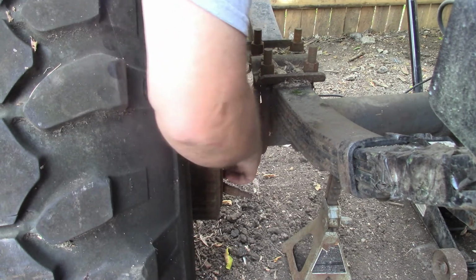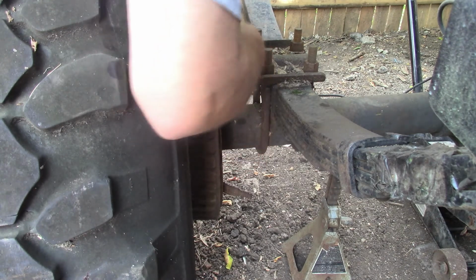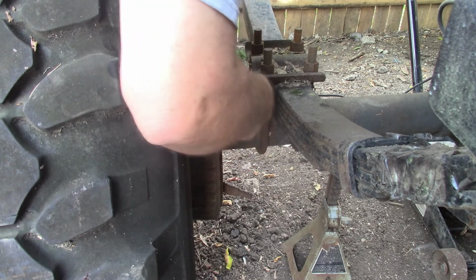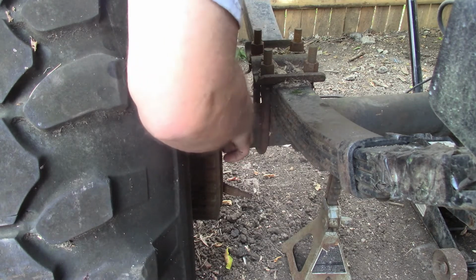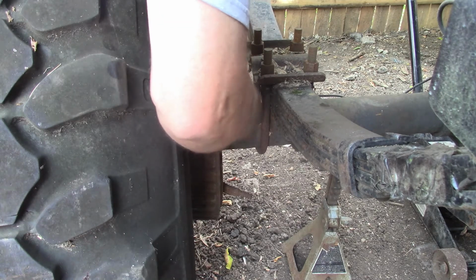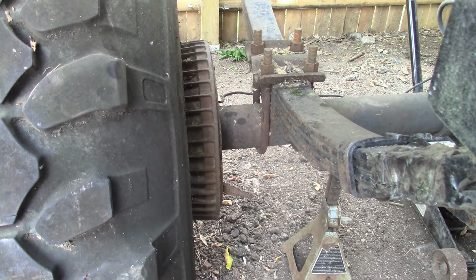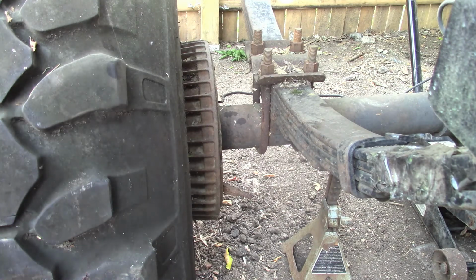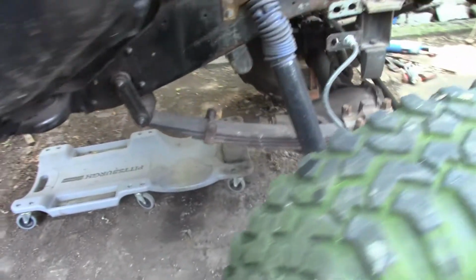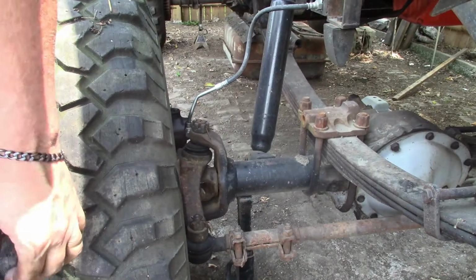And with a lot of these old bastards, you can get pressure in them with them just setting, but to get real good pressure, you got to have them fired up and running and that vacuum working. There we go. So this bleeder's free. Got the other bleeder freed up. We'll try bleeding the front ones from the lines. Ouch! Smashed my finger in the tripod. So it just leaves these two. One's twisted off. One I can't get to do nothing.